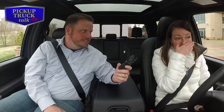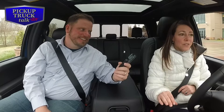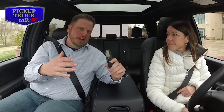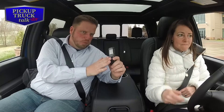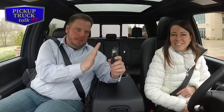Any other thoughts on towing? The turns are definitely difficult. It took a while to really realize how wide you have to be and where you have to position the tires to not hit anything — which I didn't do, by the way. It's just different. I would definitely have to do this a lot more to get used to it. I certainly would not want to do this in Chicago at all. And we did not actually have a really heavy load behind us, so I imagine that's probably very different. When you go heavier and longer, it's a different towing experience. When you make a turn, you aim your outside tire to the outside white line, you take the really long turn out, cheat a little bit, go over that line a little bit — it's totally fine. Nobody's going to pull you over for that. You're just going to make that load go smoother going around the turn.